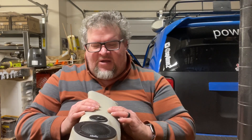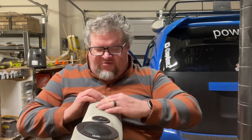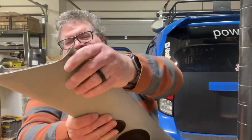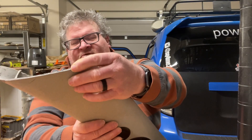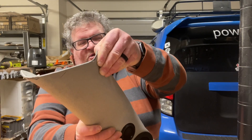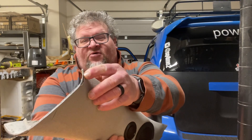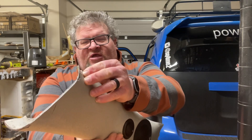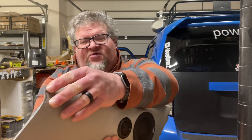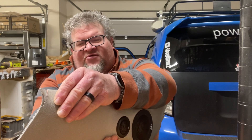The biggest place of failure isn't in the middle area — it's at these edges, and you can see it right here. This is just a minor deformity, but what happened is a lot of this was actually some bondo. This piece has fiberglass that goes all the way to the edge, but I think what happened is in the process of sanding it down and getting it to tuck into this rounding edge, it lost a lot of its fiberglass integrity and allowed it to chip away.